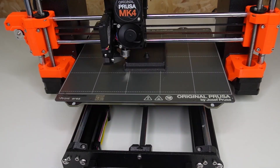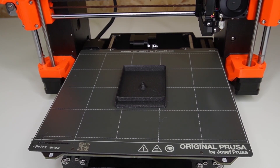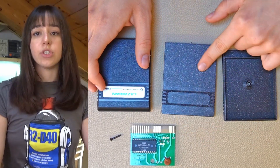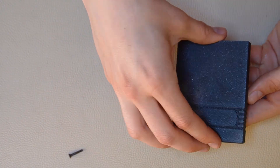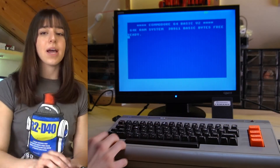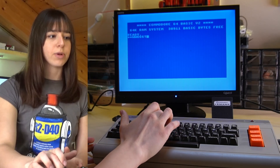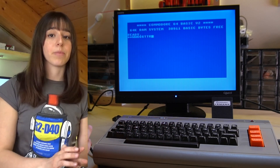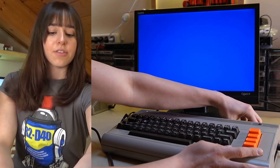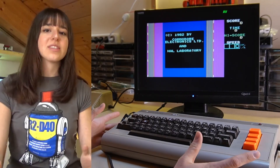That's a good one. Fortunately I have other cartridges, so by making a comparison the sizes seem correct to me. I'll put the board from the broken cartridge into the new one, and I also remodeled the label using Photoshop and printed it on a new label. I'm happy that the Commodore is working — I hadn't tested it yet — and all the keys are making contact normally. I was mostly concerned about the keys where I made the stamp to fit, because if the height was wrong they might not make contact, but there doesn't seem to be any issue. And now let's see if the cartridge works — and it loaded the game, so the sizes were correct!